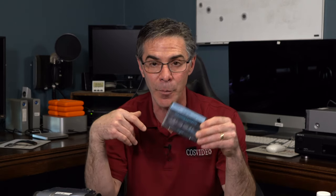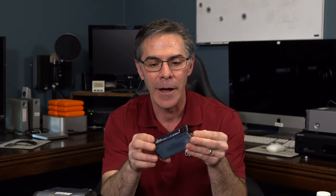The tape is starting to flake off and clog the heads of the camera — little microscopic particles breaking off. In the past, I've always loved to use an 8mm cleaning head cassette. These are great: you pop it in, hit play for 20 seconds, take it out, put your tape back in, and you get a clean picture again. But the problem is I can't find these on Amazon any longer. On eBay, a used one goes for $45–$50, and a new one can go for about $100. It's just not cost effective, so we're going to manually clean it.